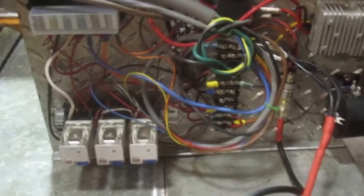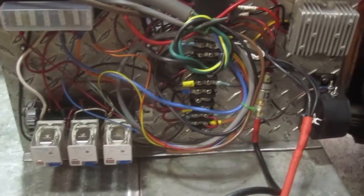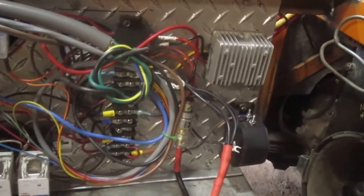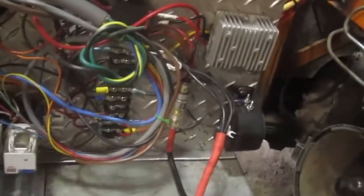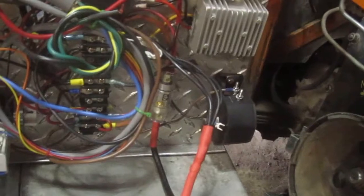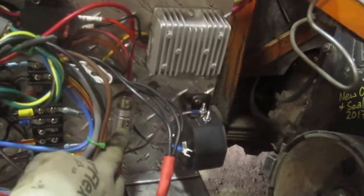The battery fits in a small area too. From the other side you can see the various logic control bits: fuses, terminal strips, relays for running the contactors and reversing. A DC-to-DC converter up here to recharge the 12 volt battery from the 48 volt battery on the other side. A reversing backup beeper, which I have removed from this test because it's horribly noisy.